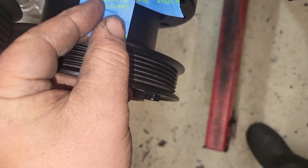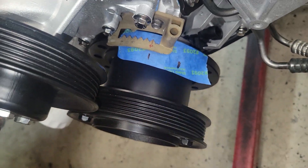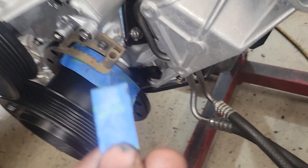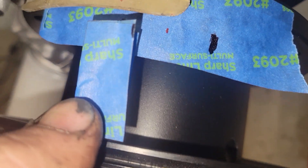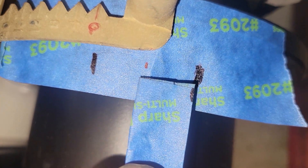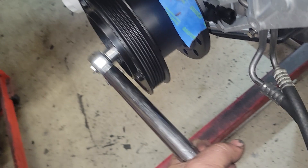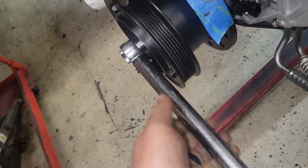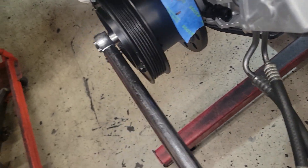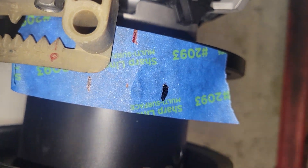We have two black marks and I made the tape. Now I'm going to fold this tape in half — here's my tape folded in half, here's my red mark, a little tick. Half the difference. I've already removed my piston stop, so we'll rotate it and see if my mark is the same as the factory mark. It is — the factory mark is right on the money.